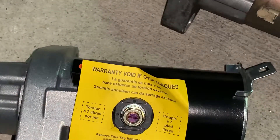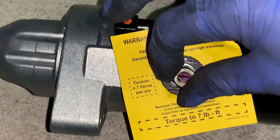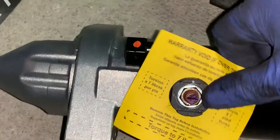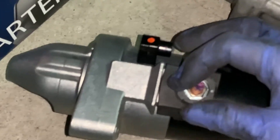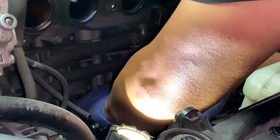Look — it comes with the torque spec right in the box. Even though it comes with a bolt, I still like using the original OEM bolt — that's just me. The reason is the OEM bolt is a 12mm head, whereas the remanufactured aftermarket starters tend to use a 13mm for some reason. Let's get those two bolts back in — 17mm with a flashlight.